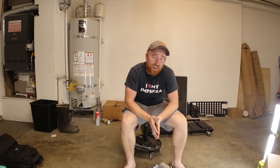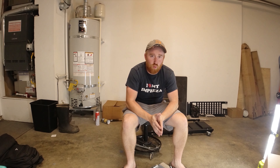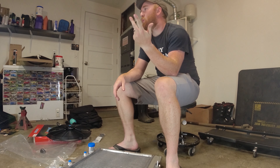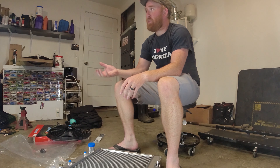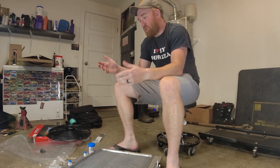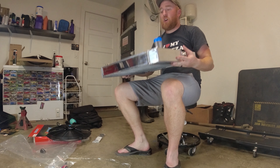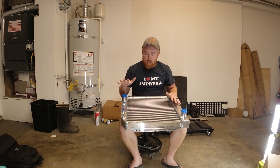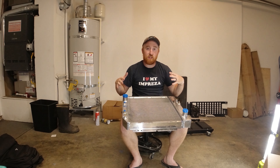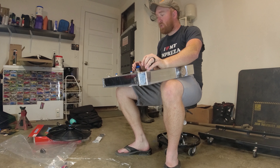There's a big debate out there about which radiators are best — dual core, triple core, quad core, or cutting out and putting a 77 to 78 Mustang radiator in there. I didn't really want to cut the core support, which is kind of funny because I ended up cutting out most of the engine bay anyway. I opted to go with an all-aluminum dual core radiator from JEGS. The difference is the inlet and outlets are actually swapped from stock since the engine is going to be sitting differently.